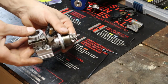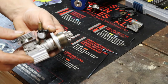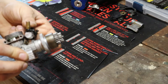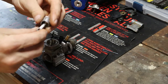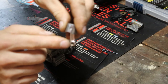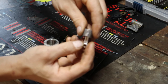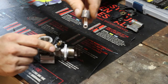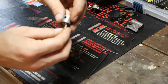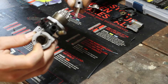I'm not going to change out the bearings or go any farther, but this is where you would take the gears off the front, your bell crank, clutch assembly, and flywheel. Once you've got all that off, you can slide the crankshaft right out the back side — nothing actually holds it in other than those parts up front. Also pay attention to these little connecting rods at the very bottom — there's a tiny hole that faces the front of your engine, towards where your gears are. That's also where the ring that holds your wrist pin in is facing, and it's important because your piston has a hole on the side to allow gases to go up into those ports on the inside of the cylinder.